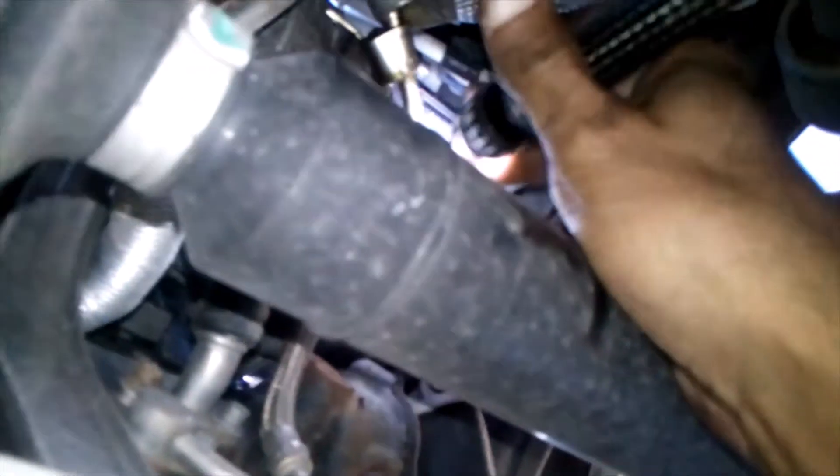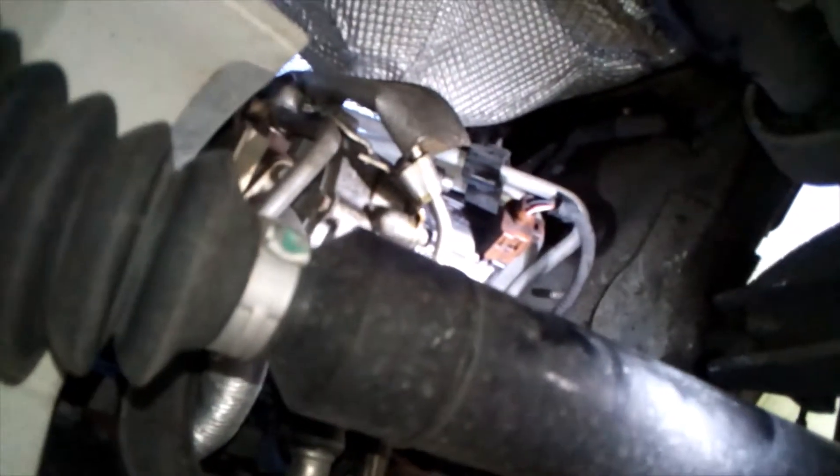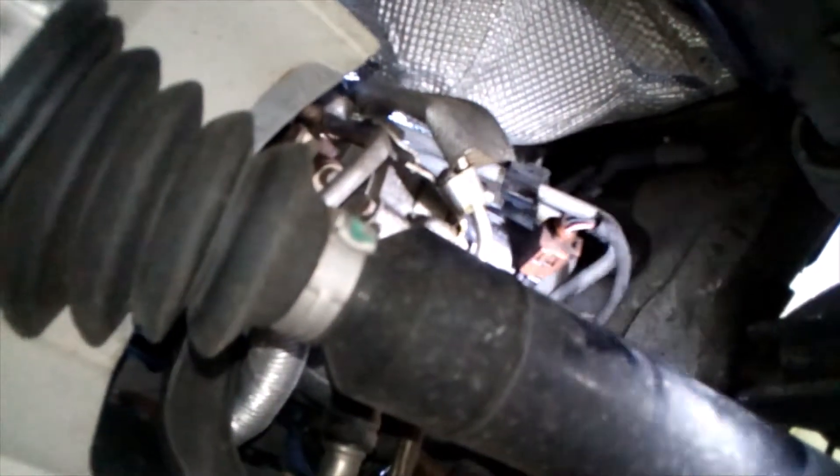If anyone's interested in how to get these connectors off, it's not that hard. What you need to do is push down on the connector towards the solenoid, and at the same time lift up this little edge right here, then pull it off — it'll come right off. That should about handle this. If this helped you out in any way, hit that like button, hit that subscribe button, and I'll be back with some more. See you on the next one.